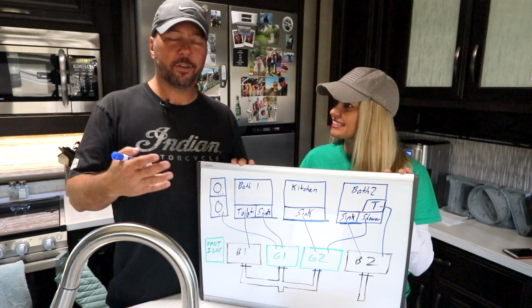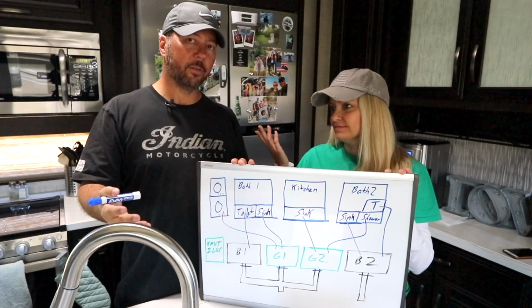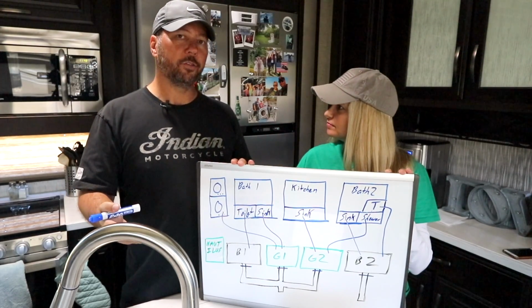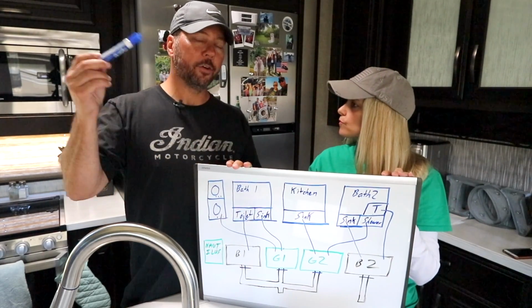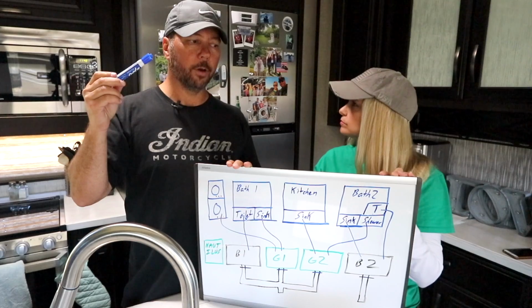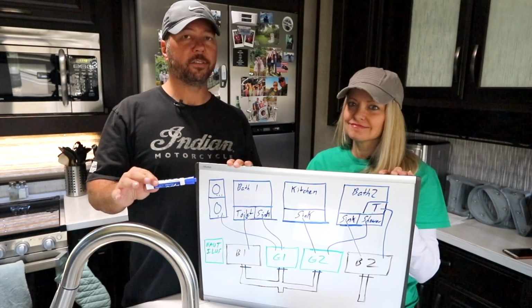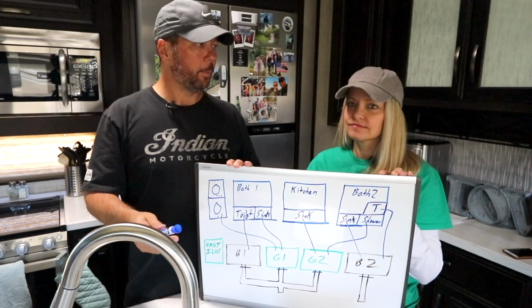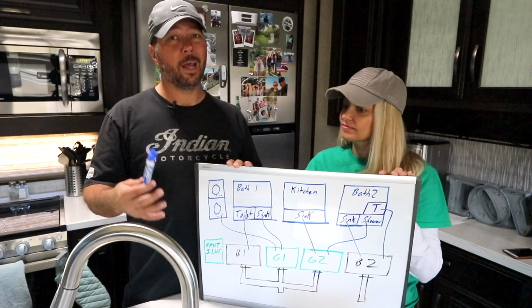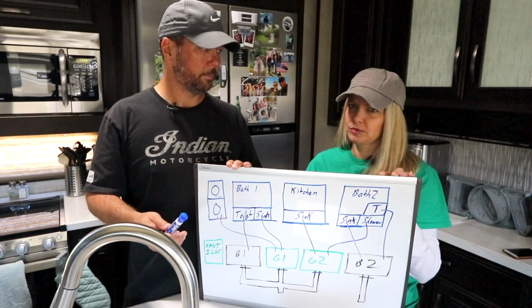Yeah. First off, they only measure in thirds, and second of all, they're completely useless once you've used them a while. Also, since the gauges only read in thirds, you have to think about this when you're using them. We mentioned that the tank gauges are kind of useless. That's true except for the fresh tank and gray one, because the fresh tank only has fresh water in it, not much there to muck up your sensors. Yeah, if your sensors are all mucked up, then your fresh water has an issue.